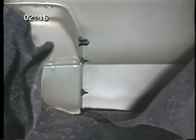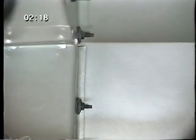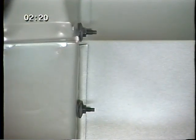If the difference is more than 2 millimeters, you can loosen the fascia mounts inside the trunk for that slight adjustment. If you can't get an acceptable match with the fascia adjustment, you might need to strip the molding off and manually reapply a new set. If only one piece needs adjusting, replace that piece. Here's how to do it.